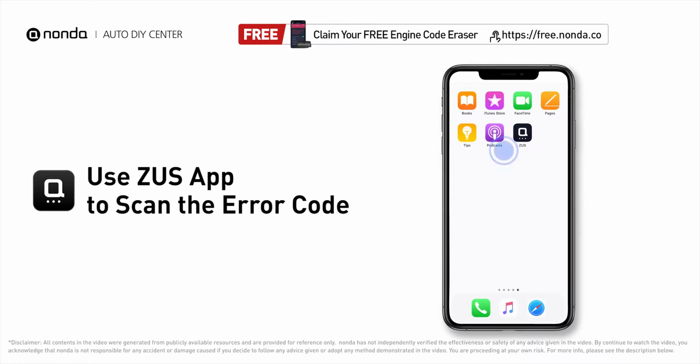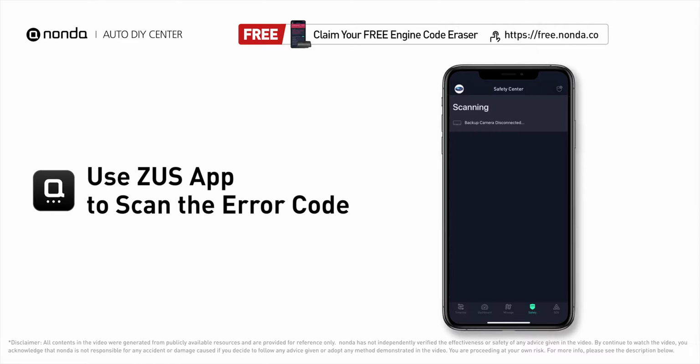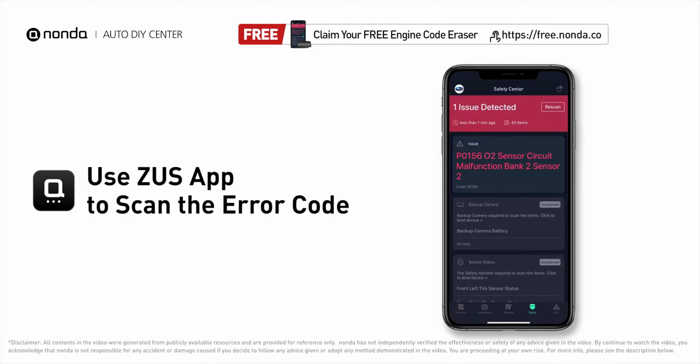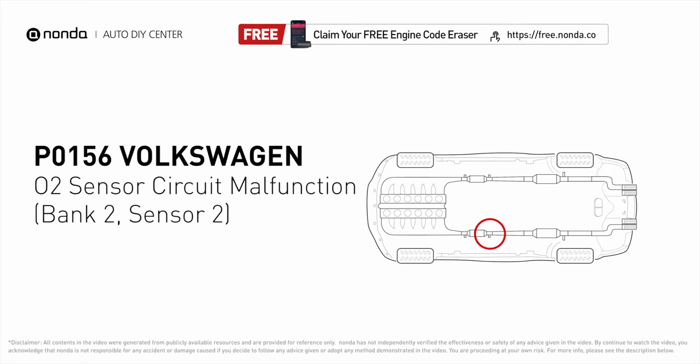Use the Zeus app to scan your vehicle and see the error code P0156. It indicates the oxygen sensor bank 2 sensor 2 fails to meet the minimum and maximum voltage limits calibrated for the ECM to see.